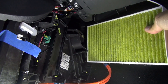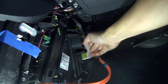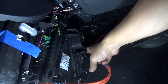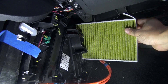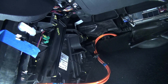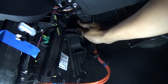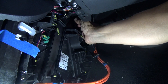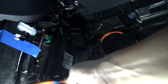I'm going to replace the new air filters anyway. Insert the air filter with the yellow part facing toward you. It's pretty easy — just push it in and it'll fall into place. Then you see the edge here, it goes in like that. Place the one on top as well. Once the air filters are in, put on the panel — there's a little clip — and then place in the screw and tighten it.